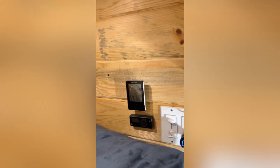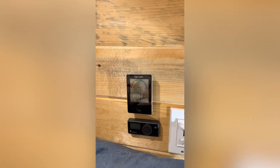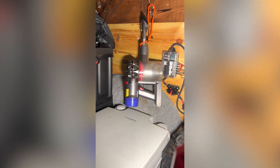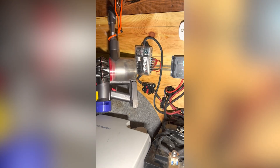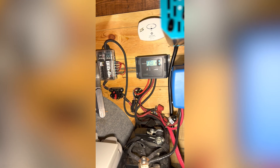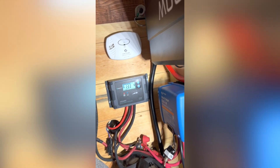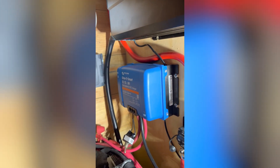This is a troubleshooting video. It's 54 degrees in the van, so the battery should be close to that temperature. The inverter hasn't been turned on in 24 hours, with very little solar coming in on a rainy day, but it is 13.3 volts resting. Here is the battery, the solar charge controller, the inverter, and the DC charger. Right now the only DC loads are the refrigerator and the puck lights, so very little amperage to draw.